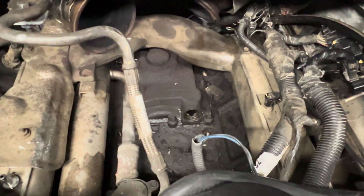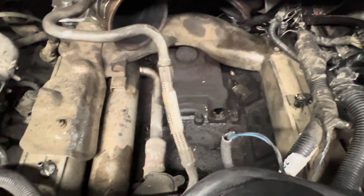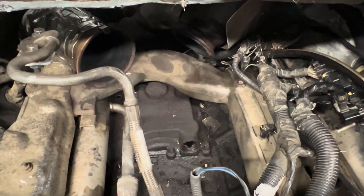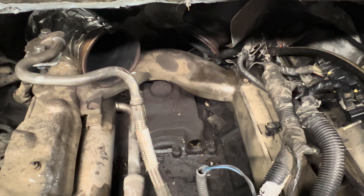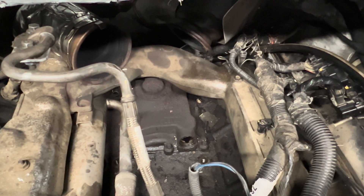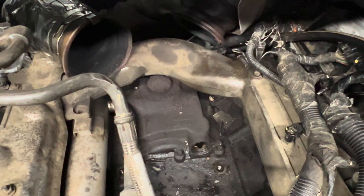I got the turbo out — lucky for me, I'm going to be doing an oil cooler, EGR cooler, and some other things on this truck. Normally when the turbo is on, it is a little bit of a pain on the '03s. In '04, the following year, they put the ICP on the valve cover, which makes it way easier to hook the hose to. So normally it'd be right there on '04 and up, but since we're working with an '03, it's on the high-pressure oil pump cover.